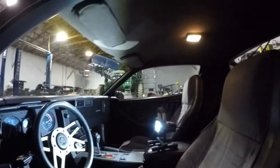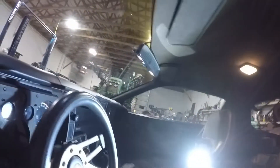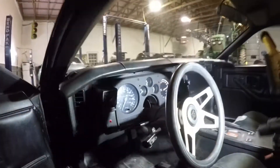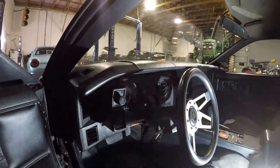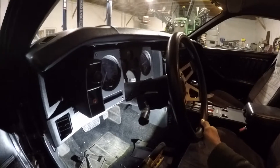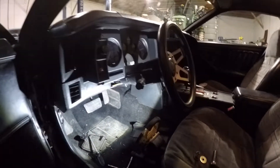The other funny little thing I found out while getting all the interior lights back working again — you can see the dome lights working, the map lights on the mirrors working, bright LEDs — is that the steering column was not bolted in correctly. It was loose. Found out the nuts are missing out of the steering column, so we're going to fix that.